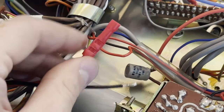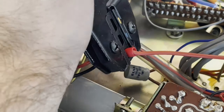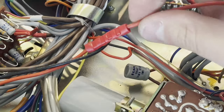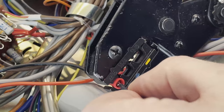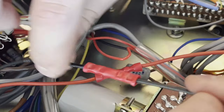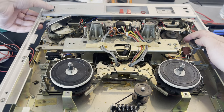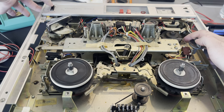The red wire is going down to the switch and then coming back up and being attached to the positive on those two pins from the original plug. Let's see how it works — plug it in, turn on the switch, and you can see the switch is now switching the 12 volt line. Awesome success.